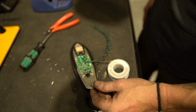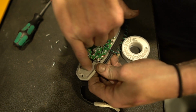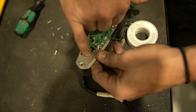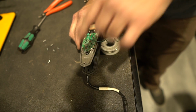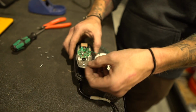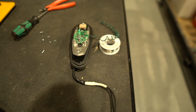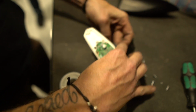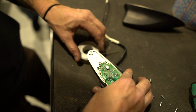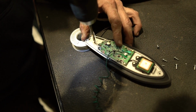And then we're going to mark this here, and really you're drilling it between all these letters. Seems to be like the perfect spot. And then you'll transfer this to the truck and index that hole, then you'll drill the hole in the top of the truck. But that's how the wires are going to come through and go. So we'll do this part next, and then we'll put the cap together. The main thing is we don't want a bunch of aluminum shavings getting up into this area here, so I'll just prop this up, do a little pilot hole.